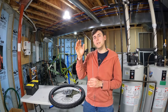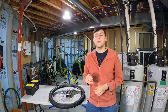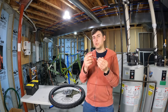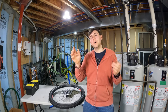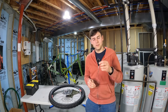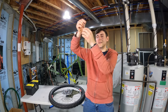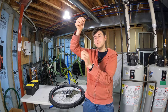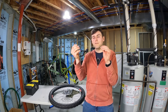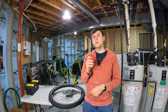The main reason is that the distance between the rim and the hub is fixed, which means the spokes' points of support are also fixed. You can tension a spoke by turning the spoke nipple — the more you turn it, the shorter the spoke, and that spoke has to stretch to make up the distance between the rim and the hub. However, a spoke would have to stretch significantly in order to break, and this really can't happen in a bicycle wheel. Unlike hanging a spoke and pulling down — where your hands move with the spoke to maintain force — in a bicycle wheel the points are fixed, so you can't maintain the force needed to actually break the spoke.